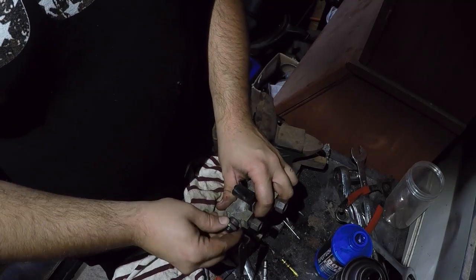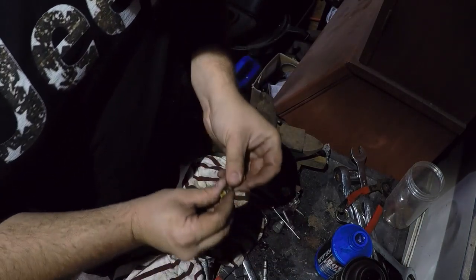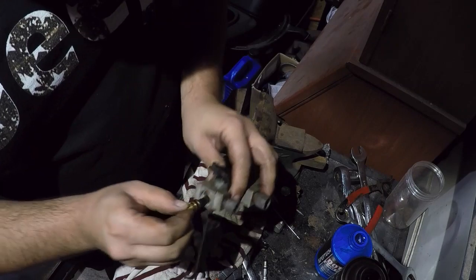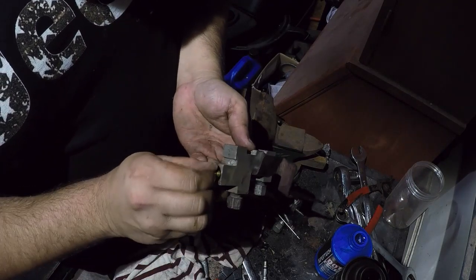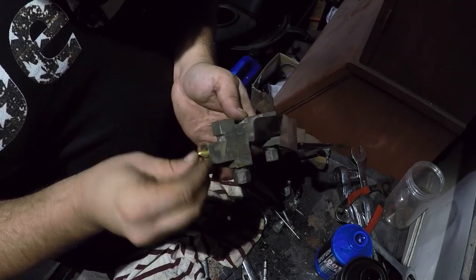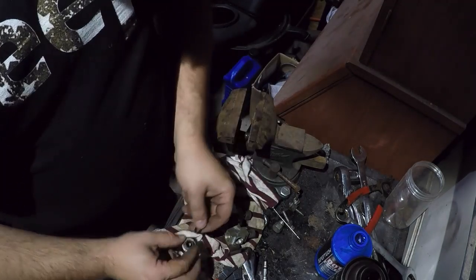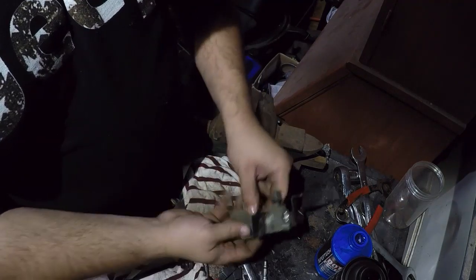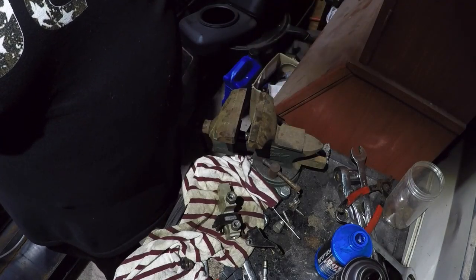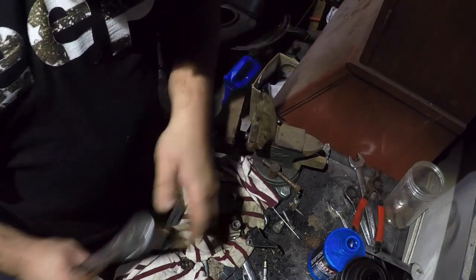Now for those of you waiting for the modification part - we're going to go to the Jeep and do it really quick. Essentially, all you need to do is take this guy off and remove an O-ring. That's the modification that should stop the uneven pressure split, from what I was told. You're probably going to have to bleed your brakes after you do it. I'll put a link in the description below of the reference I'm using for the mod.